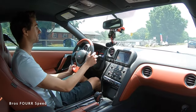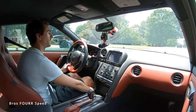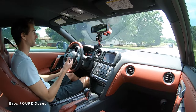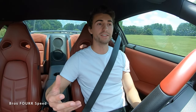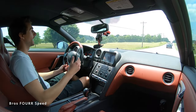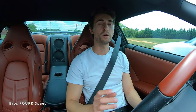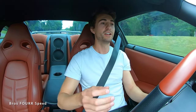I'm going to stick with the GTR on sport plus one — I think that's my favorite setting. The big benefit is just that extra level of tuning. My GTR has a lot of mods and I've tuned the engine and the transmission. Transmission tuning is all about shifting — how the gears shift, what RPM they shift at, how much pressure the clutches put on the clutch plates. Engine tuning is about fueling, timing, air-fuel ratio, boost. The Pedal Commander gives you one more thing to tune: the throttle delay from the physical pedal to the throttle bodies.